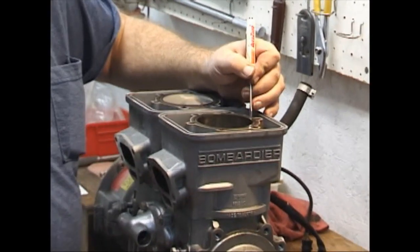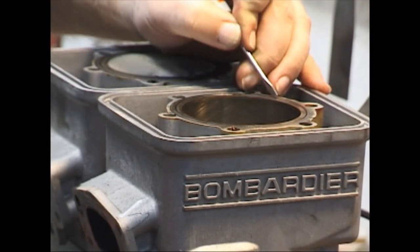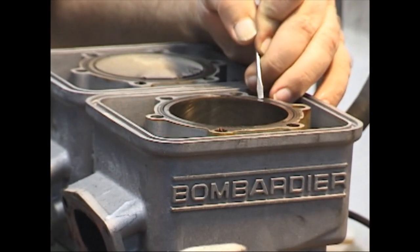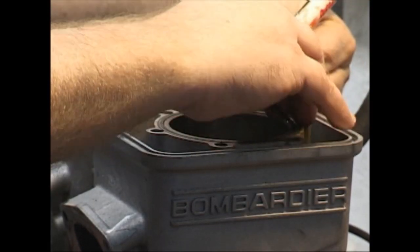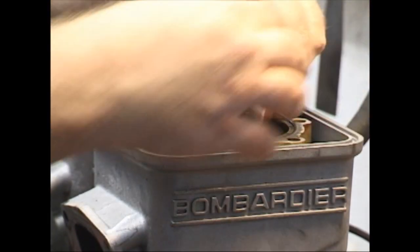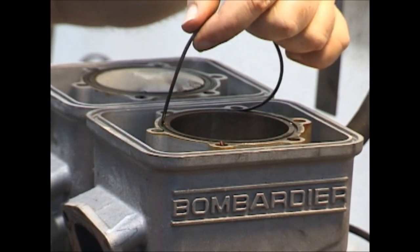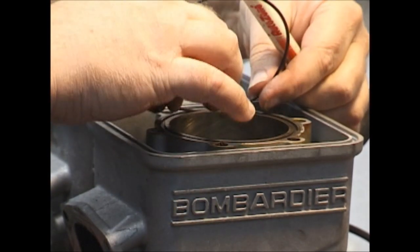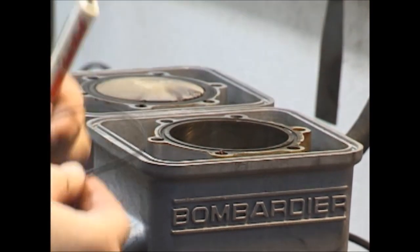Here are the inner rings — they're just O-rings of a metric diameter and a certain thickness. When these are almost melted in there, this engine I believe has been hot. We won't know until we mic the cylinders, but this doesn't normally stick in there like that.